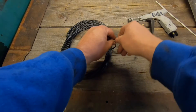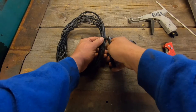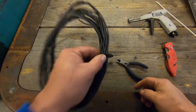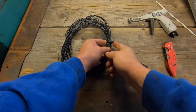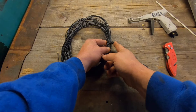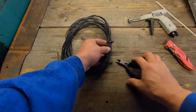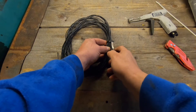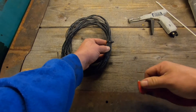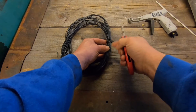When you're trimming your zip ties, don't be one of those guys that clips it off close and leaves a sharp edge right there. I've seen guys run their hands across that in a tight spot and get a cut deep enough that they had to go to the hospital for stitches. These leave a very sharp edge, so they make special cutters that will cut them off flush with no sharp edge. You can also use a utility knife — cut away from yourself — to get it flushed up.